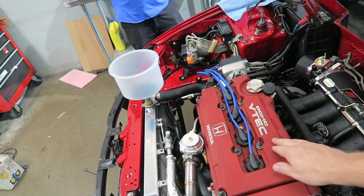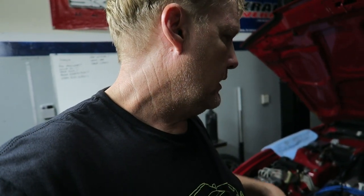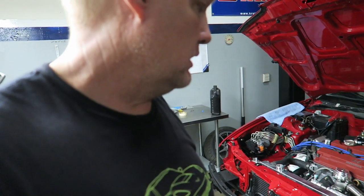That lifter's getting noisier. I must have run one a little bit too loose or something. I'm probably gonna have to pull the valve cover and take a look at that. It's still a relief to hear it run. I felt comfortable and confident, but you know what it's like — first time you start it up you want to make sure everything's right. There are so many little things that could have gone wrong. The ECU doesn't have a knock board and we had a knock sensor click, so it throws a code for a knock sensor — super easy stuff. But everything else runs good: idle's good, sounds good, good oil pressure, very responsive.